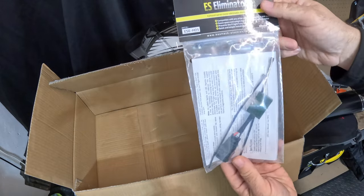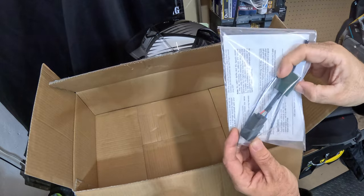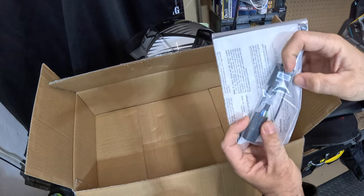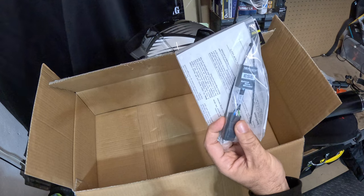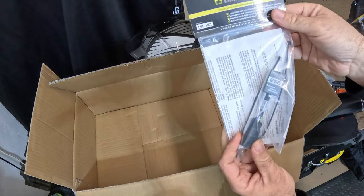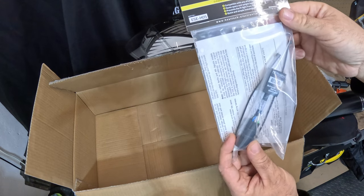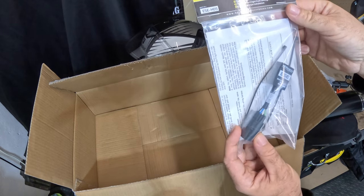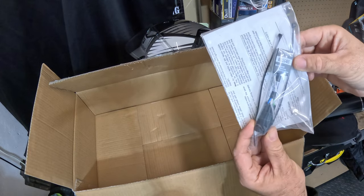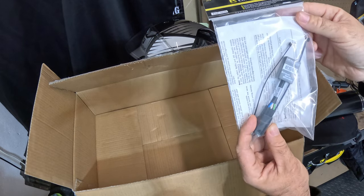This is something that I ordered separately online — you can get these on Amazon or eBay. This is for the exhaust servo. There's an exhaust servo fitted to the original exhaust which you need to remove, and if you just remove it you'll end up with engine management lights. So this gizmo costs about £45 — you remove the old one, plug this one in. Job's a good one.